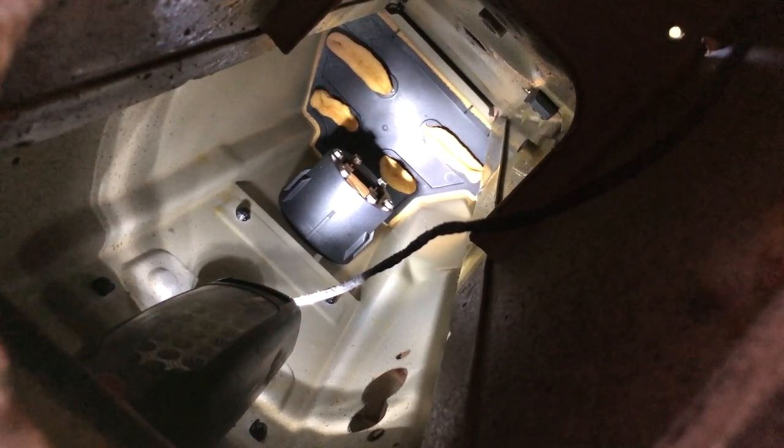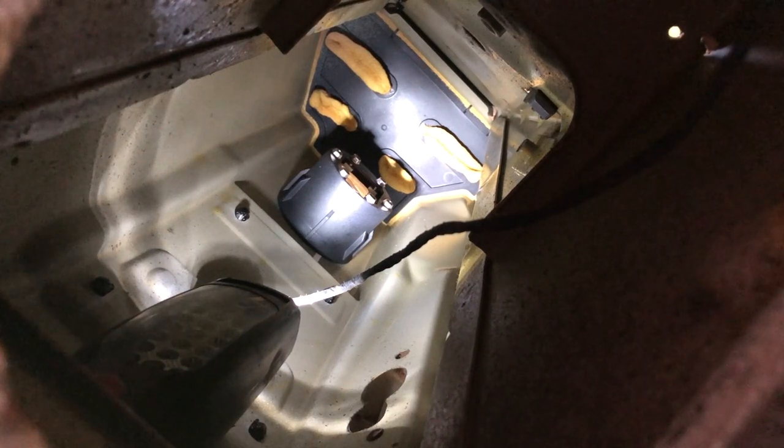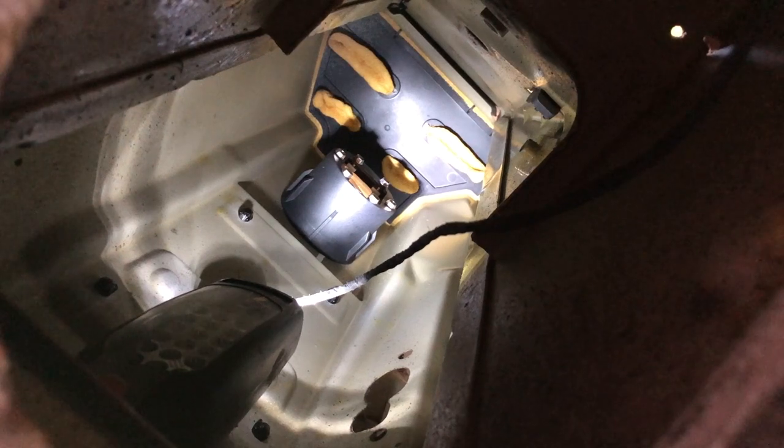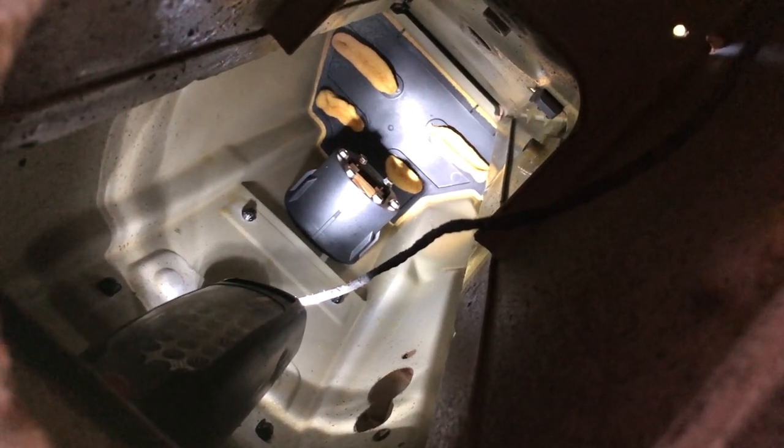So you've got them six screws in the back that hold the actual mounting part in place, and then you've got another four machine screws that actually hold the bayonet fitting into it. So what we're going to do is make off the bayonet fitting part to the actual fill pipe. I'm going to make that off outside so we can get it nice and tight, because there's no way I'm going to get spanners up there. Make that off in the vise in the work van, and then we're going to feed it all through. There's a plate that goes behind, four machine screws through into that threaded plate, and that's what holds it all in place. So we'll get that done now.